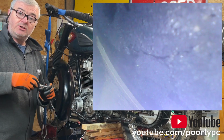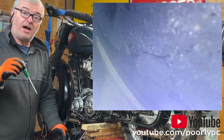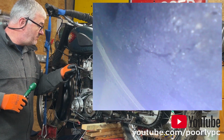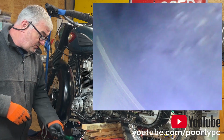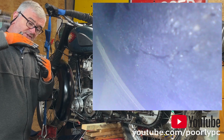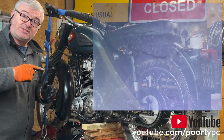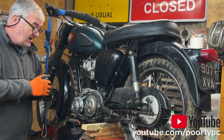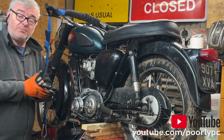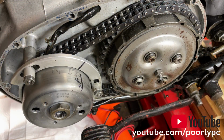I've used a drop tool, I've used a screwdriver, and I've used a DTI gauge bought from Poland with a 14mm thread. All of which was a little bit ambiguous around the top dead center mark, simply because it's quite an oblique angle, and that's the problem for me to get accurate timing and to set the timing statically at top dead center, 35.5 before top dead center on the stator and rotor alignment marks, and we'll have a look at that now.